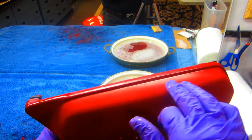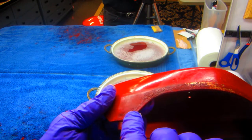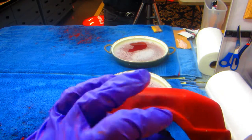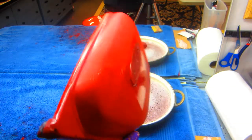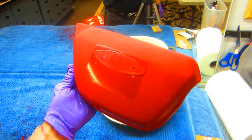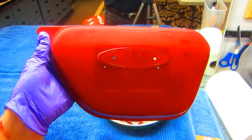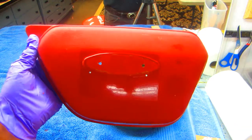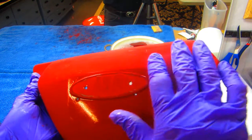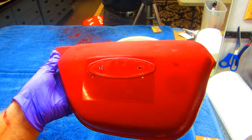While the bondo is drying on the first, this second side cover is pretty much a carbon copy — there's a lump here, some cracks in the paint, the same old 70s paint coming unglued. It's not really the paint itself; the thinner goes in and attacks the paint underneath. When the Honda 750 first came out in the early 70s, a lot of people were custom painting these bikes and they all did this. Through a process of elimination — trying different thinners, spraying things dry, not using acrylic lacquer — modern paints are better, but you can still always have that crazing problem.